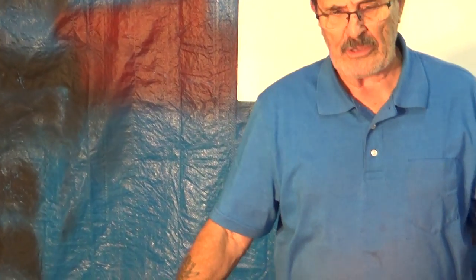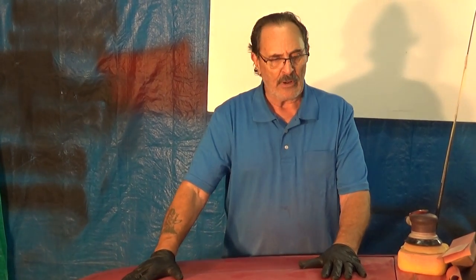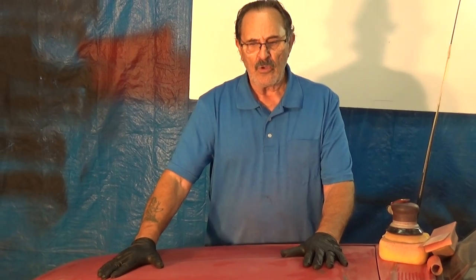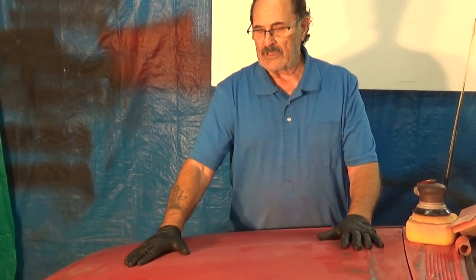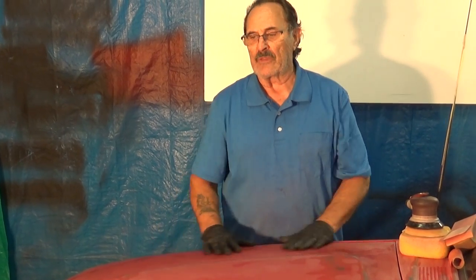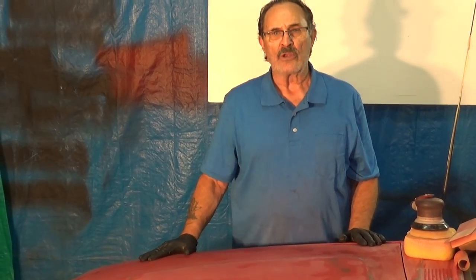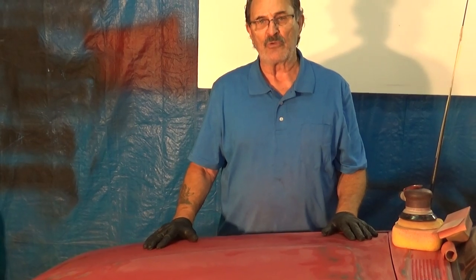I've about got this original color cut down — it was red. I have it cut down to the point where I've got just a few things left to finish, and then we'll finalize this with a couple of activities using some equipment that will get it ready for the primer to go on. Once I put the primer on, I'll sand it down, and once it's sanded and prepped properly with no rough places and everything smoothed out, I'll put the color on with the color code, then go after that with the clear coat.